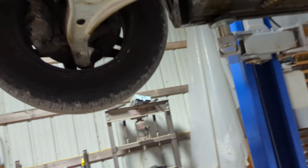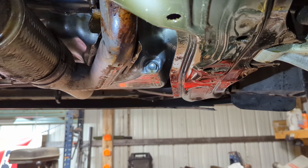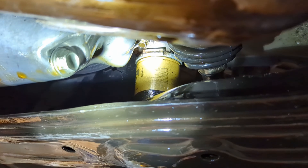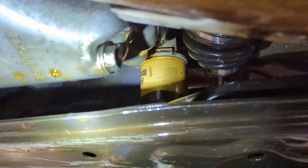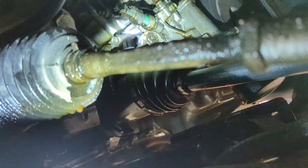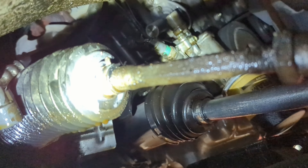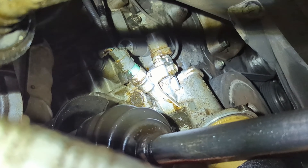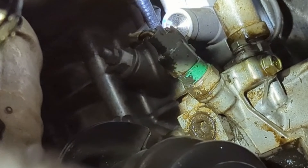As you can tell, this hole underneath is just completely soaked and bathed in oil, and I'm not sure where it's coming from. There's oil all over the oil filter housing. Maybe it's something as stupid as the filter just being loose. Although, it does look like there is an oil pressure switch on the back — I'll put a little arrow on the screen. It might be leaking from there.